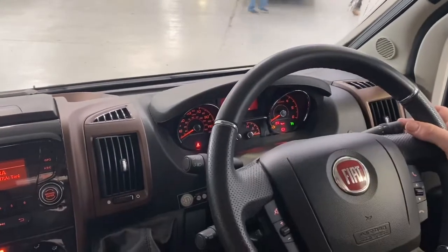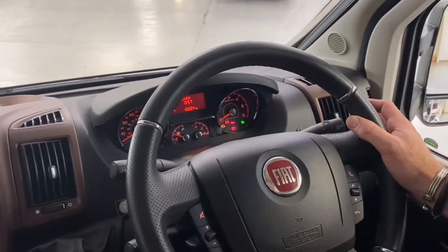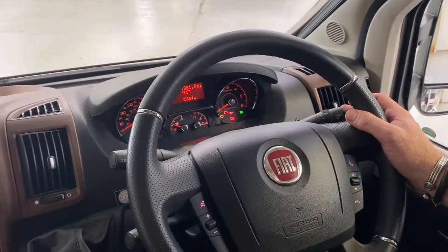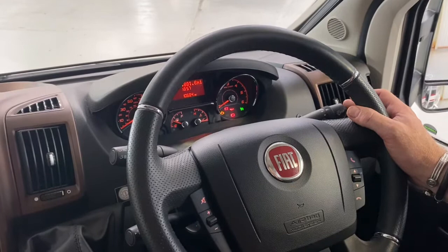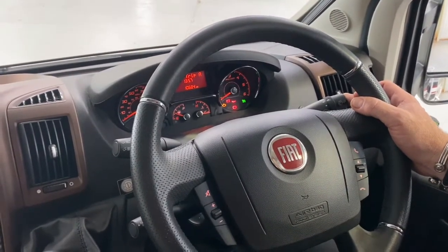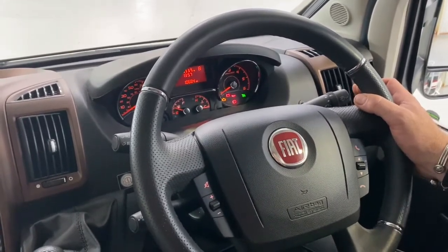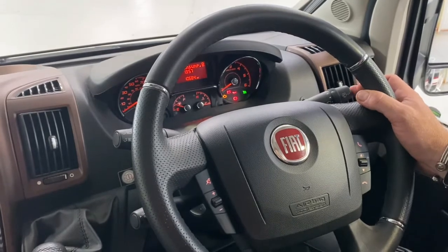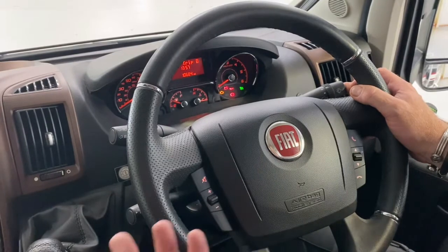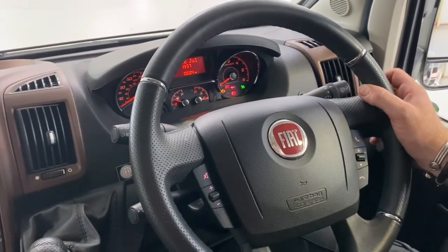If you go to the end of your wiper one, this controls your little panel there. So if you press that, it'll give you the range. The trip distance, if you get a second, it'll show you how long the trip is, which it says on that one. You want to reset it, just hold it in a little bit longer, and it says reset trip A, and there you are, it's all the way back. You'll go through trip A all the way to trip B, and again it'll say average consumption and all that sort of stuff. You just press that a bit longer than you think, and it resets trip B. You go all the way through trip B, all the way back to today's date.